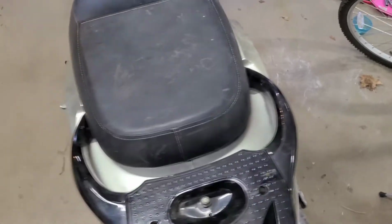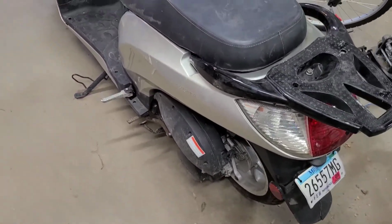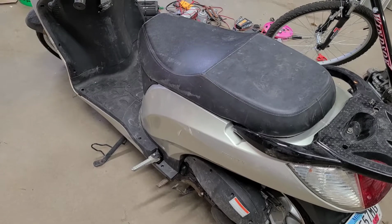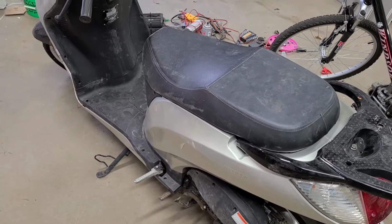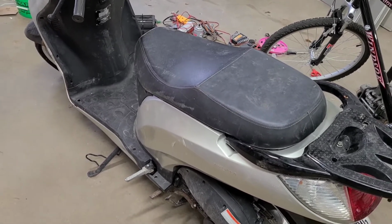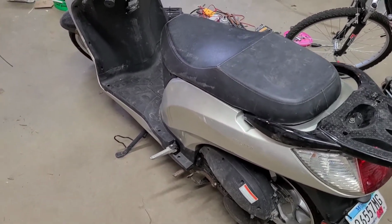Learned my lesson with these carburetors. I probably had the carburetor off 3 or 4 times, doing different cleanings on it, and it still didn't run very well. I had to keep a couple fingers over the snout of the carburetor, choking it a little bit just to keep it idling, and at that time it wouldn't accelerate at all.